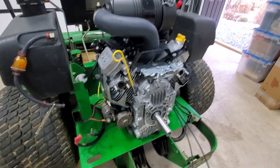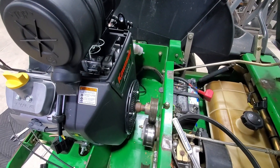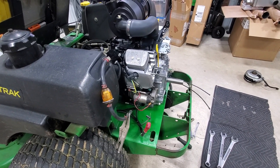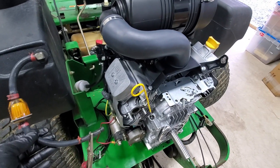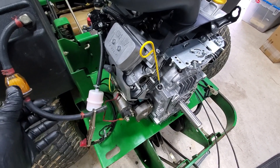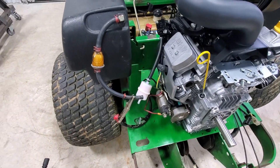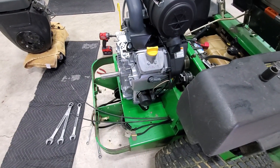I have the motor set in place — I just dropped the bolts through the holes but haven't locked them down yet. As you can see, the pulley lines up right where it should for the drive belt. Everything sits right in there. At this point, reassembly with all the conversions is identical to disassembly. The only difference is this one comes with a slightly different fuel filter, so I'll figure out whether to use my original setup or the new one. Once I have everything back together, I'll come back on and we'll start it up for the first time.